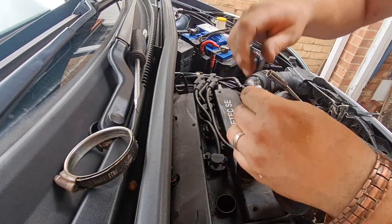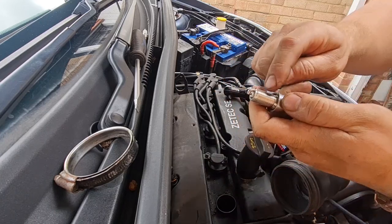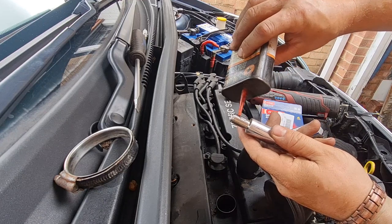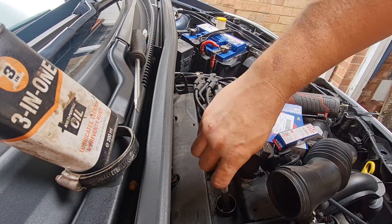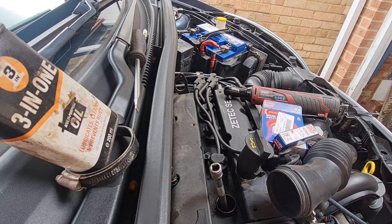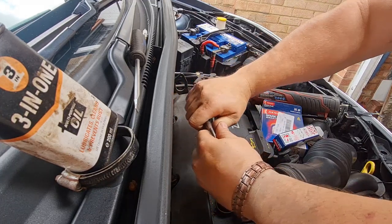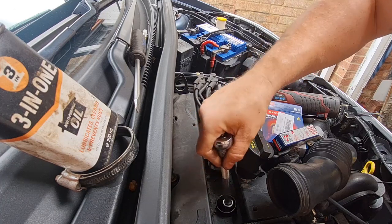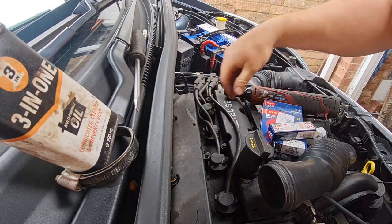They look fine, so let's get those fitted. I usually start them off always by hand. What I'm going to do as well is put a little bit of three-in-one oil on the thread to stop it sticking - that will work its way around as you wind it in and stops it getting corroded in the future. Wind them in by hand and I'll use the manual ratchet just so I've got a good feel of how tight. I don't want to go too mega tight - just enough to crush the crush washer, nip them up. And that is your first spark plug done. I'm going to carry on and get the other four done exactly the same, and then we can move on to doing the air filter.